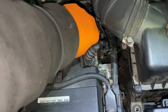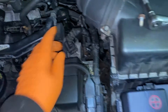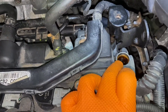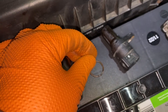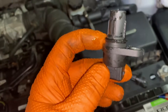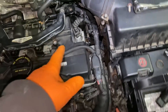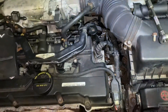Put it all the way in and make sure it seats. Wait — why doesn't it have an o-ring? Let me check if it fell off. Actually, it does have a seal — it was stuck inside the housing. If there's no seal, this would cause a vacuum leak. The new sensor didn't come with one, but I have o-rings. Make sure when you order the sensor you get the seal. Don't put it in without a seal, and don't reuse a worn old one either, because it can leak and cause a vacuum leak, giving you misfires and everything.